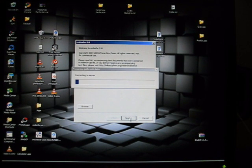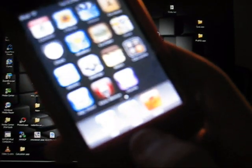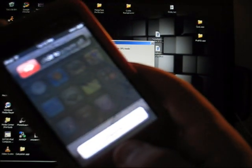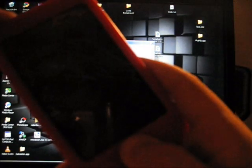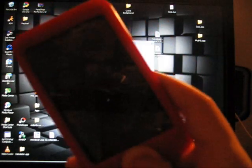Alright, so it identified the firmware — just hit Next. So you need to go into DFU mode. To do that, hold the top and bottom button for 10 seconds. If you're plugged into the computer, you'll hear it ding. As soon as it dings, let go and hold the bottom button until it dings again. Which will eventually happen. There we go.